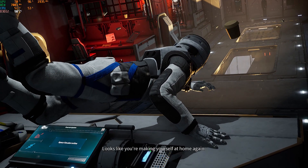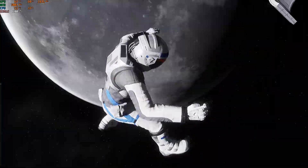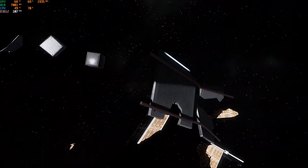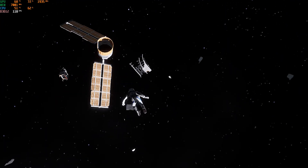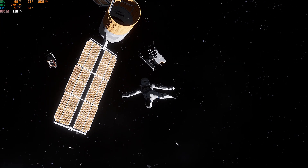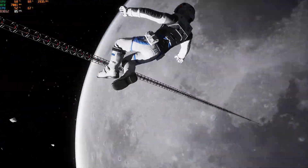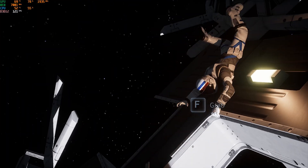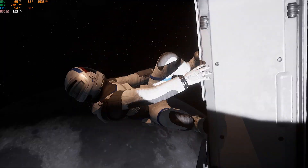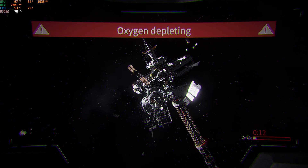Now, if it's worth it for you, that's entirely a different story — you have to make that judgment. Of course, like I mentioned, if you have a higher RPM fan or a better fan providing higher airflow push-through, you can probably find another two to three degrees Celsius down, maybe even more. I don't know — depends what kind of fan you're having. But yeah, absolutely. If you can shave another couple of degrees, that will be better for the computer and for yourself — you're going to get better frames.